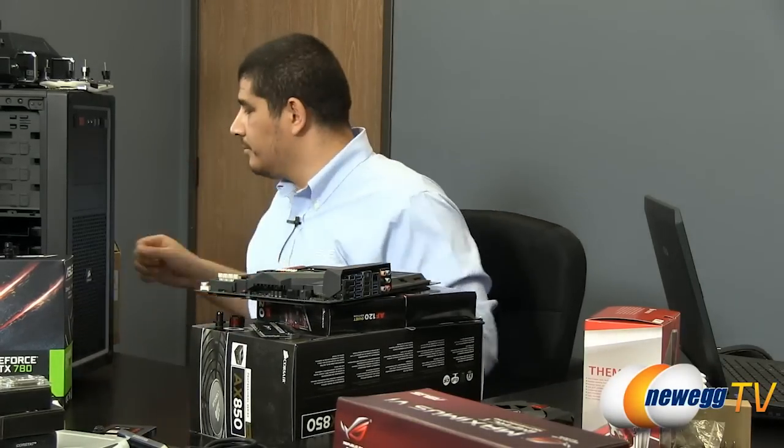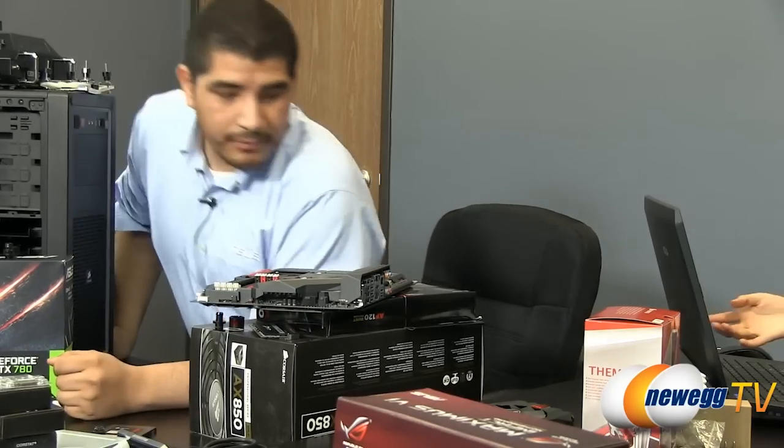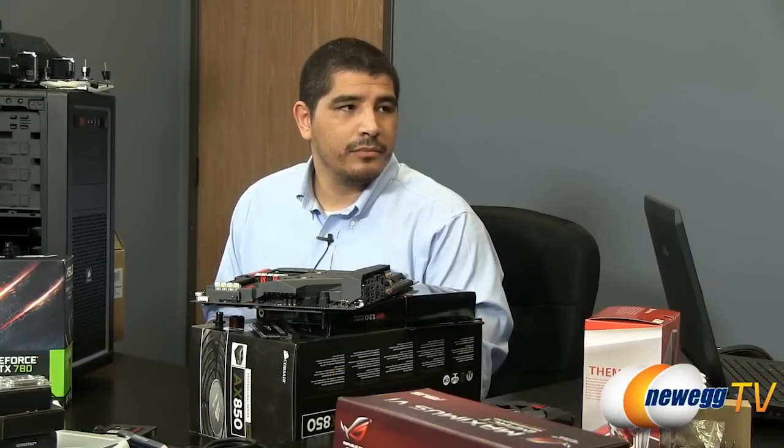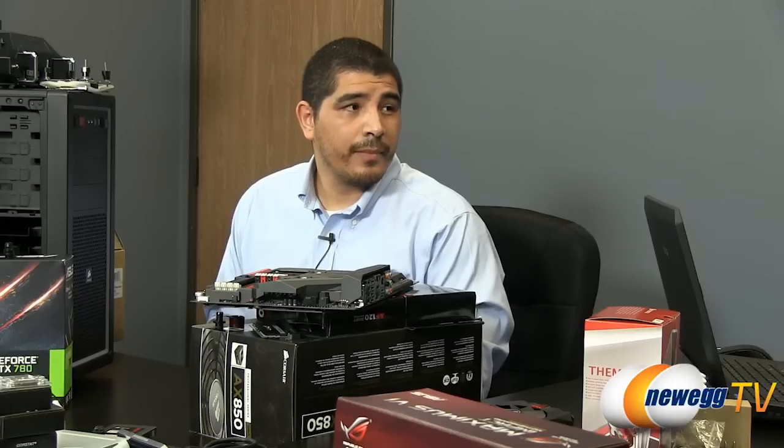Okay. We have a question. How do you reduce the noise of a hard disk drive, or do you? I think most modern generation drives are actually fairly quiet, but easiest probably is, I guess it varies on your chassis. The little silicone mounts can help reduce noise from the spinning and vibration, but if your drive is making the click-seek noise, there's no real way around that. Yeah.